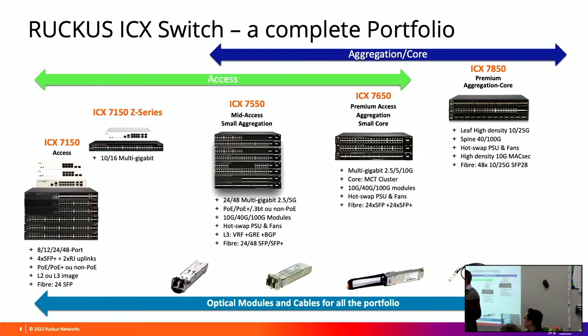Let me show you a couple of scenarios. One scenario is with the 7150 family. With the 7150, you've got the four ports on the side which are all the 10gb ports we use for stacking. These ports could be stacking ports or fibre uplink ports to another part of the school. You could take one link and connect two switches - that's a stack. You're consuming one port on each switch, leaving three ports on each switch for uplinking. If you wanted more bandwidth, you could put a second link, giving you 20gb of bandwidth between those two switches.